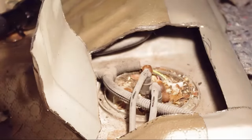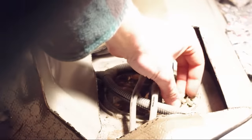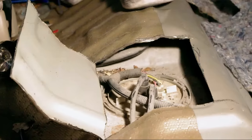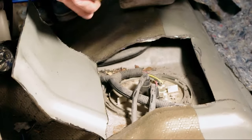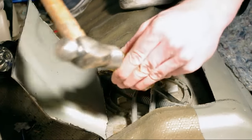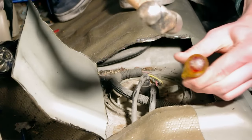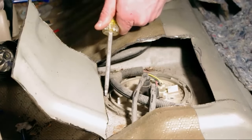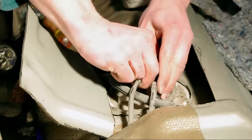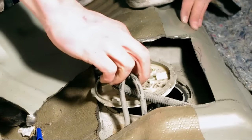Now just change your fuel pump. There were actually squirrels living on this one, hiding acorns and chewing up other acorns on top of the fuel pump — maybe they like gas fumes. Next, take a flat screwdriver, line it up with that circle, and tap it. It will walk the lid of the fuel tank out. Break the ring free, then wiggle loose the rest of the fuel system so you can walk it out and change the pump.